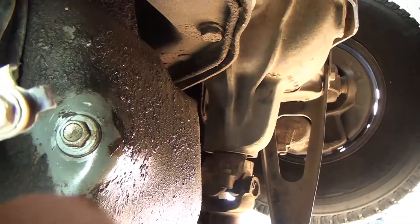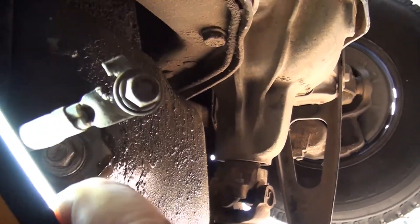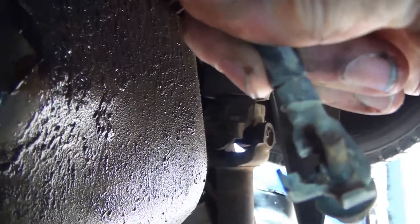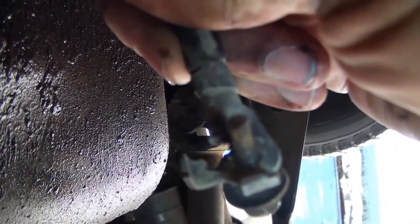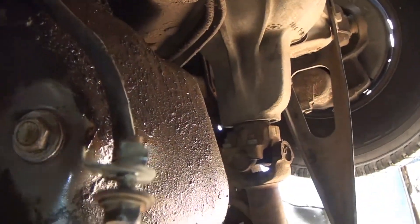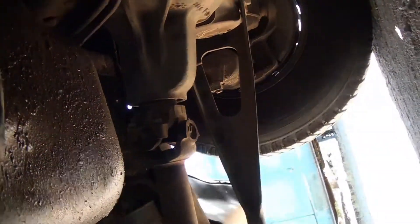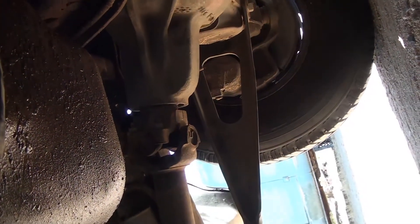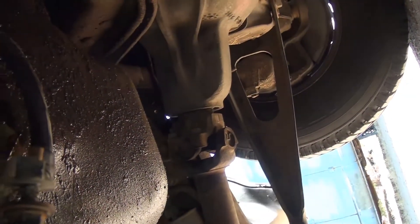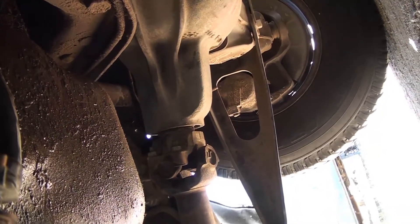That one just seemed to be moving a little bit. Okay — the cable was loose, and you can see, after I removed it from the starter, where it had been arcing. This is the underside — you can see where it's been arcing. There's still enough material there to make contact. I'm going to go ahead and put this back on the starter and order another cable for it, change it at another time. For now, I believe this will work. And if I have any more trouble with it, I'm pretty sure I'll know where to look.